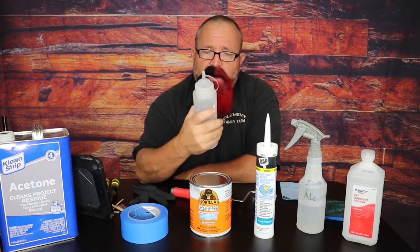My main product is acetone — that's what I wipe everything down with. You'll see me doing that in the video; I'm constantly wiping it down. I put it in these bottles — they're chemical-grade bottles, you can buy them on Amazon. I'll probably leave a link to everything I'm using down in the description. These bottles are great: you put the acetone in there, you can also put isopropyl alcohol in there. The small opening helps keep it from evaporating out of the bottle.